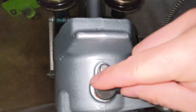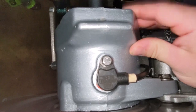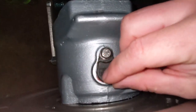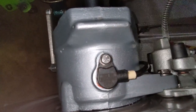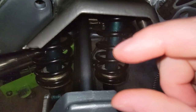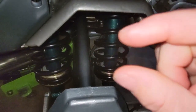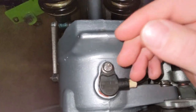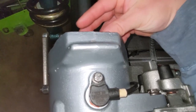Although they look lovely and clean now, and they're greased and slotted back in — when you take them off, this aluminium housing here, the hub carrier, is just covered in corrosion. That hole becomes very tight and you just cannot press this out. It's got a black plastic top and then about an inch long shaft, covered in a very thin stainless steel cover. Pretty fragile design, Jaguar. When you press it out, you end up damaging it, and that ruins the clearance between that and the spinny cog thing of ABS-ness that is in there.